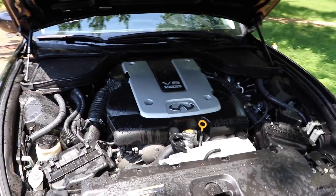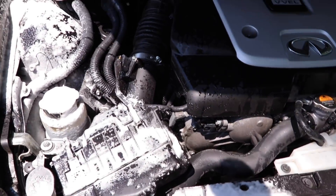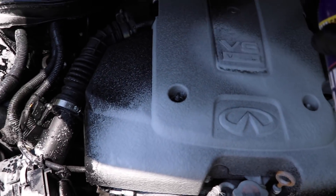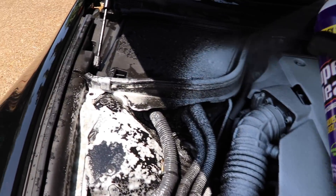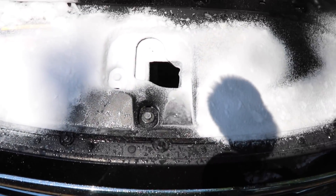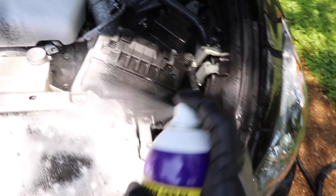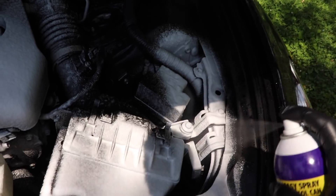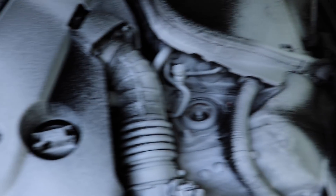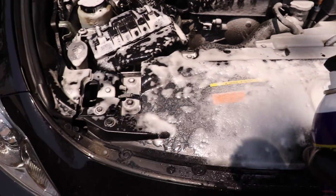Next, I'm simply going to take my same aerosol degreaser and dress the entire engine with it — apply and clean the whole engine. One thing I love about the aerosol can is that it's a constant flow. You can see how I'm getting into all these cracks and crevices. I'm not being unsafe, just not overly conservative, because I've been doing engines for about five years and engines are so watertight these days that it's not something you need to be overly concerned about. You need some common sense and caution, but you don't need to be overly worried.